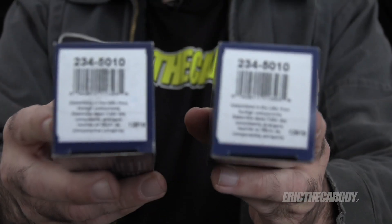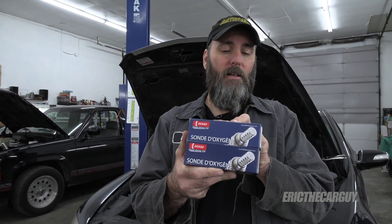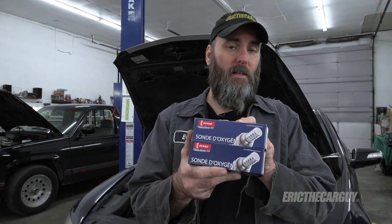These are the primary oxygen sensors located at the top of the catalytic converters on both banks of the engine. They both have the same part number. I didn't get Honda parts, I just went for these Denso parts, which I believe are the original equipment manufacturer anyway. So in other words, I got these a lot cheaper than if I bought them through Honda. I believe they're the same part.